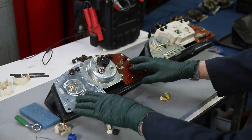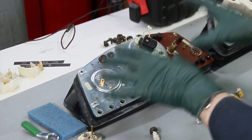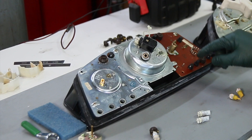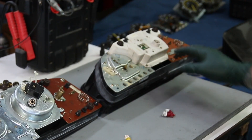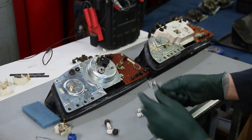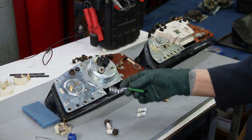The W123 chassis here runs from 1976 to 1985. You have two bulbs right here that control the brightness of the instrument cluster, and all the other bulbs are for something else. Pay attention, folks — I had one guy write and say it doesn't fit down here. The W126, produced from the 1980s to 1991, also has two bulbs right here that light up the instruments at night. Juris and I tried to come up with a tool to take these bulb holders out, but it didn't work.